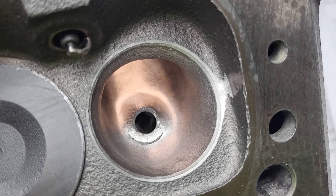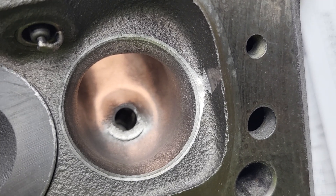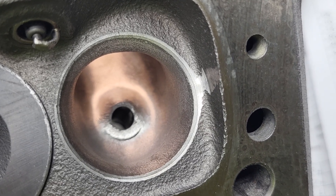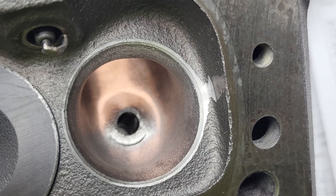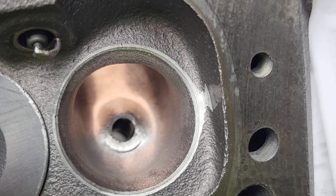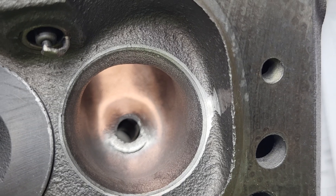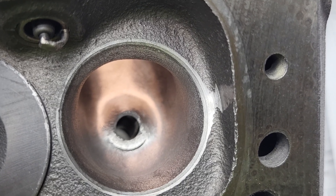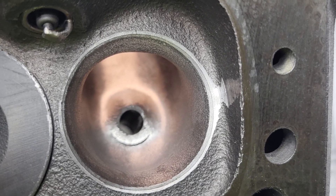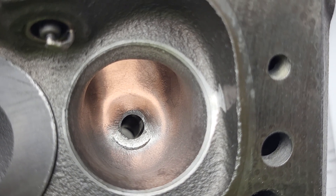We're inching up on where I like an exhaust setup. I tried to keep our variables to a minimum, so basically the only thing that's changed is the overhang on our short side radius — it's much less than it was. As of this moment we are 1.34 inches at the throat from left to right, and 1.4 inches top to bottom. If you average that out, it's about an 84.3% throat ratio — better than the 83.75.